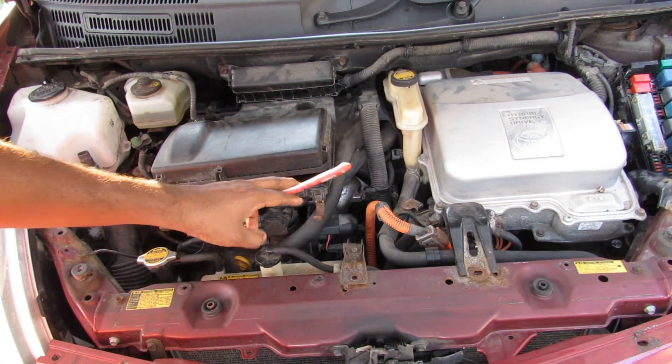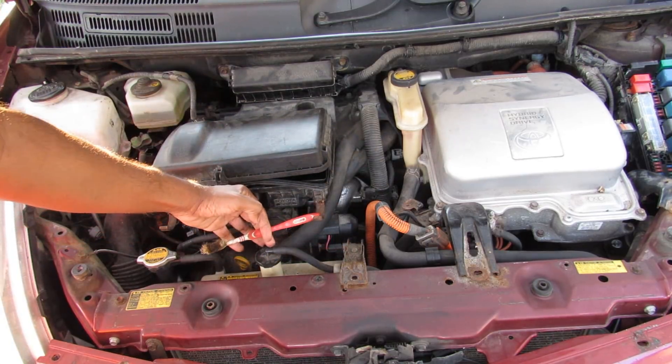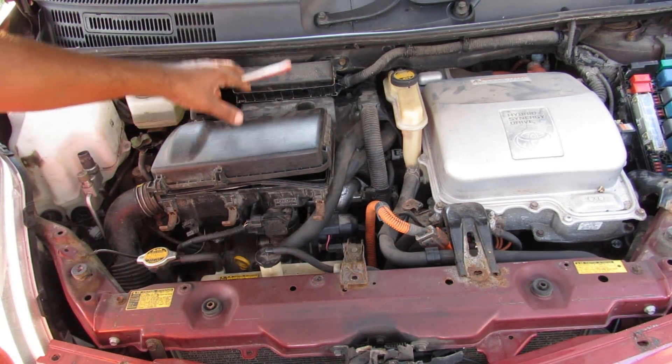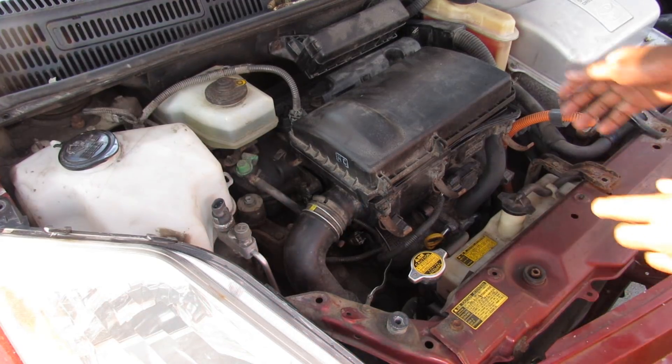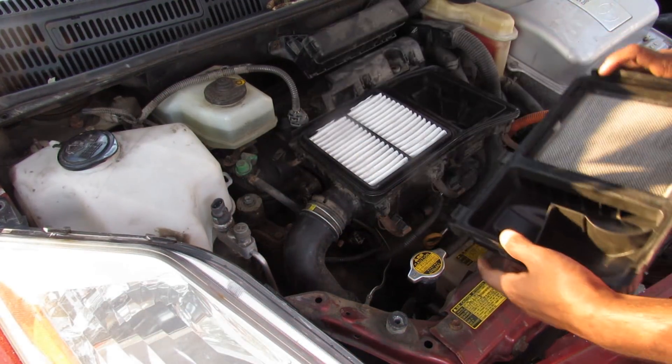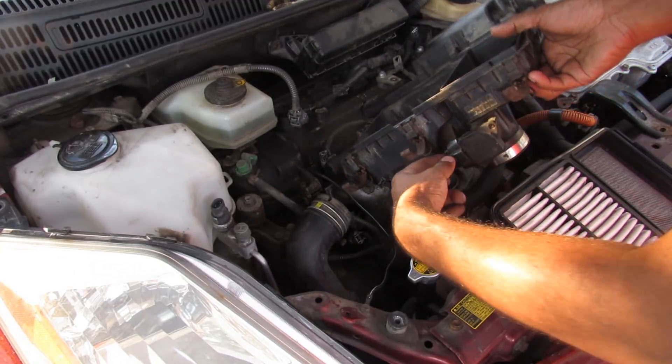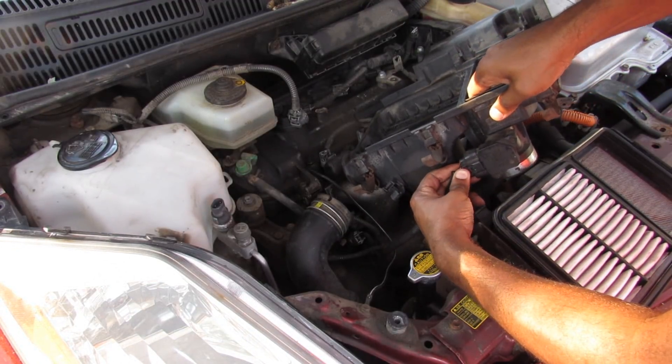In order to clear things up we're going to need to remove a few things: the inverter itself, the fan and radiator assembly with its bar, the air box, and the wiper cowl. Up at the front I've already loosened off a few things, such as this air box which just pops off with its filter and comes off the assembly at the mass airflow sensor.